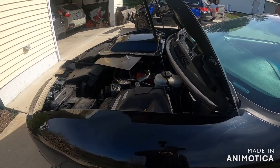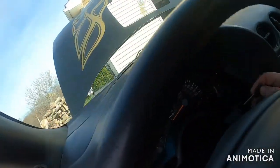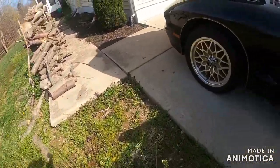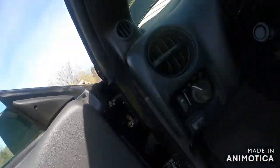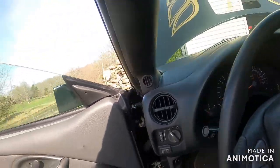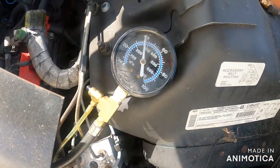Something could have happened to this fuel pump - I've had the lines blow off inside the tank before. I can't even hear this one engage anymore. Now you don't have to crank to start it - just key on and you should hear it, then come out here and check the gauge. As you can see we have 40 PSI. I don't believe 40 PSI is enough to make this old puppy start - I think it runs in the range of 58 to 63 or so. See, it doesn't even go up. That indicates to me: fuel pump is poopy.